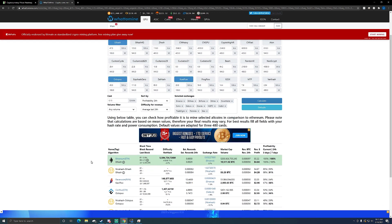The problem is I don't think I can run multiple on it, but we'll see. So those are my results: the 3060 mining ETH getting roughly 47.5 to 48 megahash a second. This driver does work, but there were just some workarounds — you had to have it on your motherboard, you had to have the HDMI or a dummy HDMI plug to get a signal out of the GPU, and it won't work on a riser. There has been confirmation of two working at the same time, so I do have the dummy plugs ordered. Hopefully they'll be here tomorrow and I can test my MSI 3060. I think I can get that one a slightly better megahash because it has better cooling, so I can probably push the VRAM a little harder.